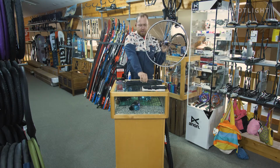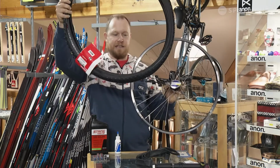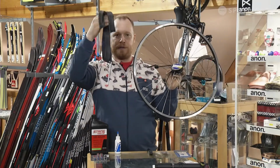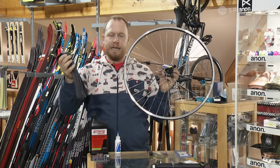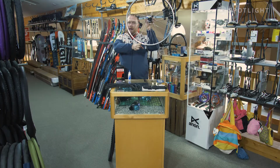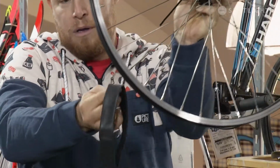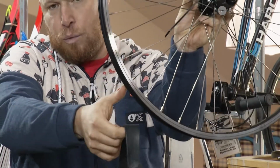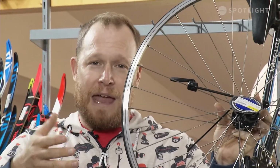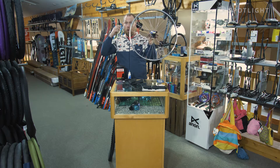This is your wheel. This is the tube that runs inside of the tire. So you've got the tire, and the tube sits inside the tire and on top of the rim. What you're doing is you're getting rid of this part of the system, and the reason why you're getting rid of the tube is because tubes can pinch flat. A pinch flat is when you impact something hard enough, say a rock, a curb, whatever, that it goes through the tire pressure and then pinches the tube between that hard object and the rim. It'll cause two little holes side by side that we nicknamed a snake bite. So anytime you see two holes side by side, that's from too low air pressure impacting something, and you'll get that snake bite hole pattern.